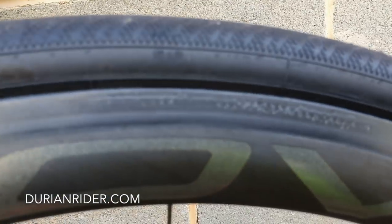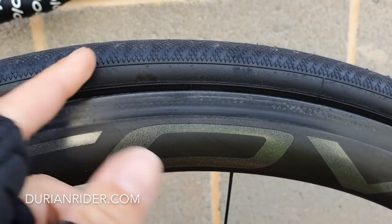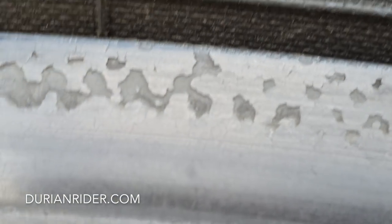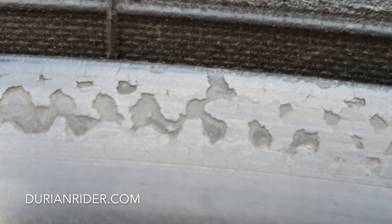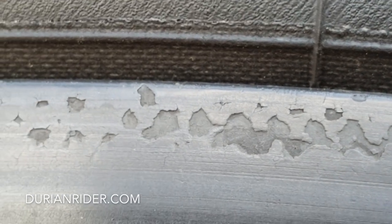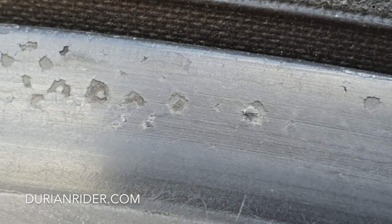We're going to check the rims as well. I'll take the tires off, take the rim tape off, and check all the eyelets for any cracks. This is the first thing I notice on this one — here you can see the voids. Is that safe to ride? There's a bit of cracking in there. For me it'd be okay, but I probably wouldn't feel too comfortable with someone else riding it. A heavy rider might have an issue. It's just the carbon delaminating. That would be a weak point for a heavier rider, in my opinion.